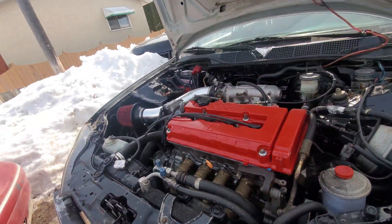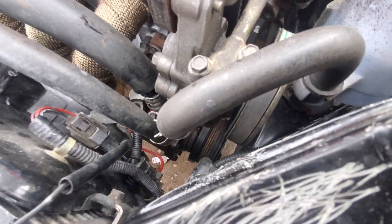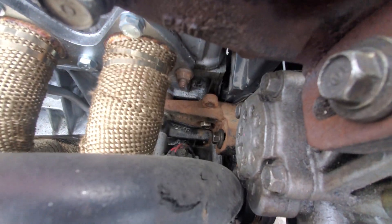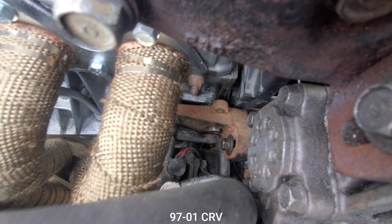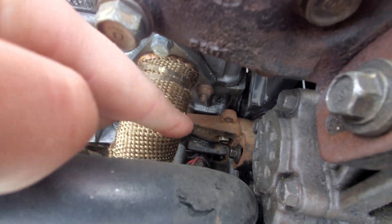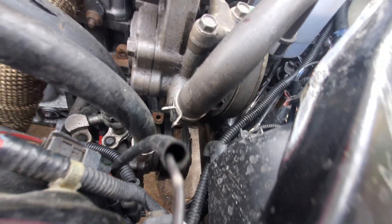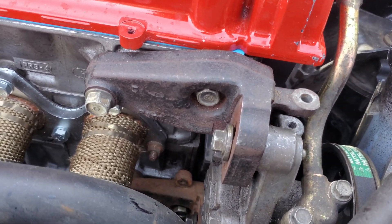This is still in the works, but this was our last warm day so I thought I'd film all the stuff now. For the AC — way down there — the easiest way is I used a D series, my D16 Y7 AC compressor. The way I got that mounted on is I grabbed a bracket from a 97 CRV — any 90s CRV should work. When you rip the compressor off there are some stamped numbers on it, and you're looking for the P7J. That will allow you to mount up the D series compressor onto a B series engine and still have the stud at the correct height.